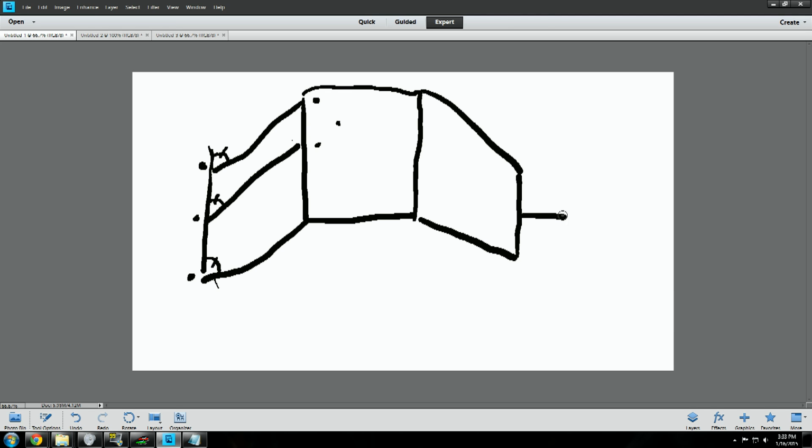Now essentially what that would do is, as your suspension works and the tire moves up, this one right here is going to hold its place more than the shorter A-arm. So this shorter A-arm will actually pivot in. When the suspension is all the way down, this might be totally vertical, right? So your tire is 100% vertical and perpendicular, everything's straight with the world, right?